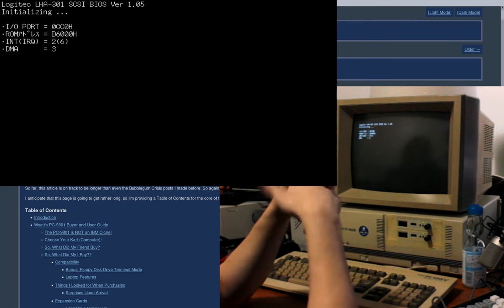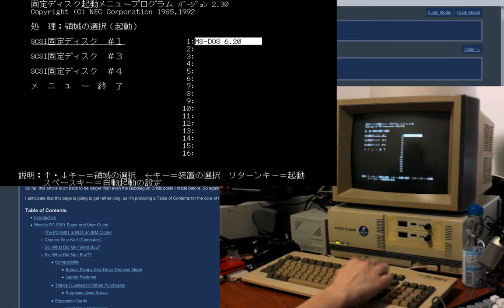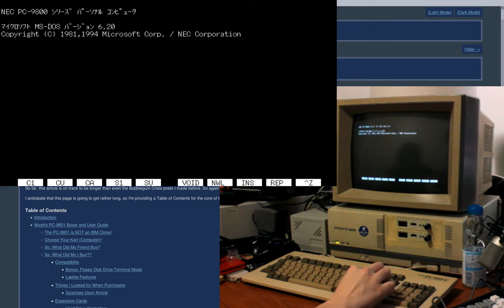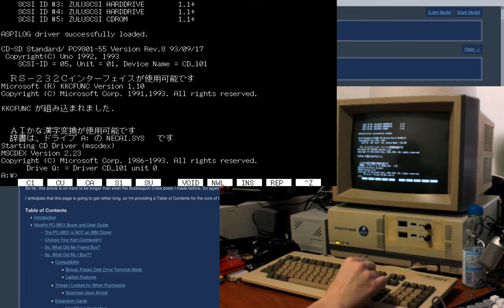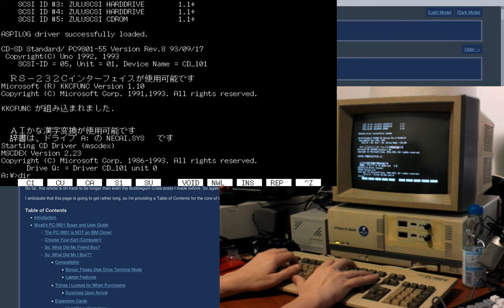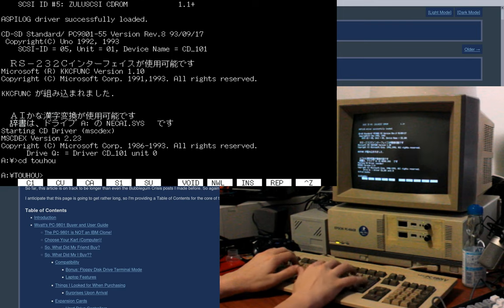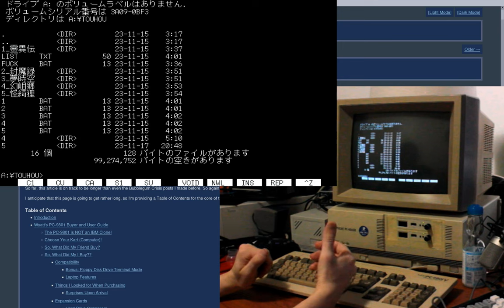But yeah, the first two or three games would work with the interrupt setting wrong on the SCSI controller. But 4 and 5, I think, would not. So, yeah, like I said, fun to figure that one out. Why two of them just went to a black screen versus the others working flawlessly, when no one else seemed to be having that problem. Then again, almost no one else has my setup.